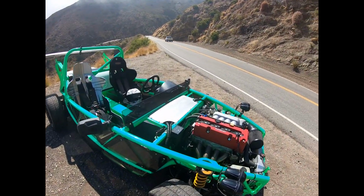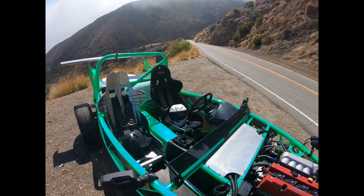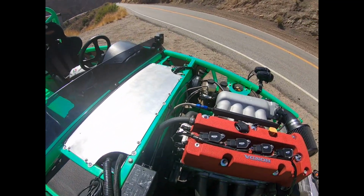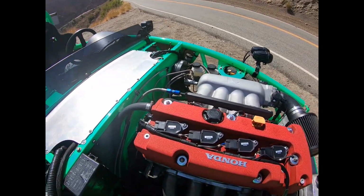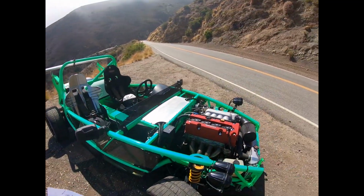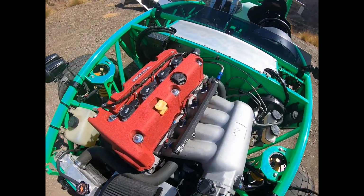So anyway, no more exhaust fumes in what we call the cabin, so that's a lot better. Those of you who have a valve cover breather with a filter there up top, you guys are going to be smelling some stuff. So I'd recommend putting the K-swap vent down here, somewhere away where it's not going to get into the cabin. Next thing I did recently was swap out to RDX injectors.